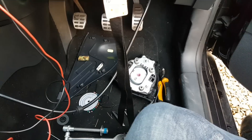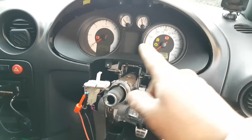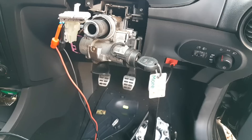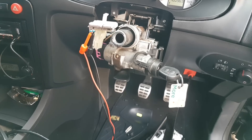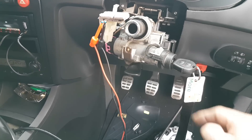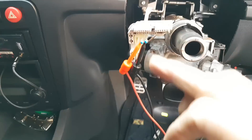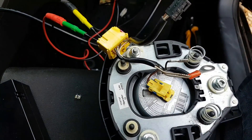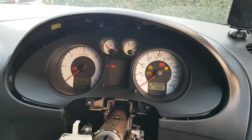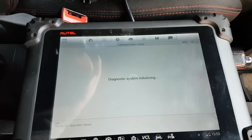So I'm a little confused whether I actually have a bad airbag now - the wires are good, I can make the light go off just by getting the right resistance. The one last thing I want to do is put the clock spring in place and try again. But if I connect the airbag directly now, my light doesn't go off. I'm now connected to the airbag and theoretically the light should stay off - but as you can see it comes back on, and my fault is going to be resistance too low.